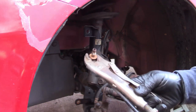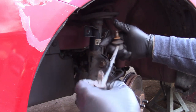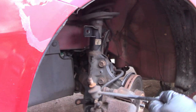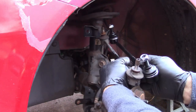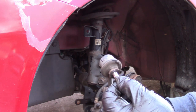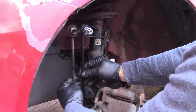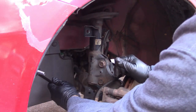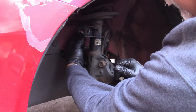I tried a pair of vice grips clamped onto the back side of the shaft. Had to go with a bigger pair of vice grips, but now I want to show you something important. If you look down the end of the shaft, you'll notice the ends are offset — one is twisted slightly more than the other. You need to find the piece in your kit that matches that orientation. If you use the wrong one, they'll be facing the wrong direction. Pick the right one — I already know which this one was — and verify by comparison with the old one.